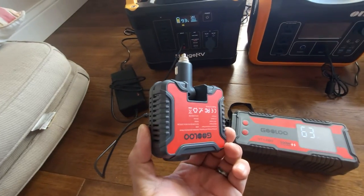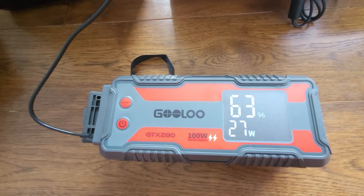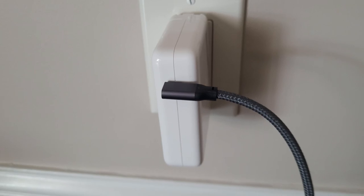To charge this unit, you have to use the bi-directional USB-C port, which can support up to 100 watts of charging. However, it doesn't come with a 100 watt charger. In fact, it only comes with this inverter, which also acts as a DC charger. You plug it into a cigarette lighter socket and use the USB-C port to connect directly to the charging port, but this is only rated for 30 watts, so charging this way takes about 10 hours. However, if you have a 100 watt USB-C charger, you can charge this in as little as two and a half to three hours. The manufacturer claims the 100 watt charger uses a private protocol, so you'd need to buy their adapter. However, I found that using a USB-C 3.2 or higher cable along with a MacBook 95 watt charger, I can charge this at 95 watts.